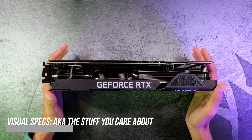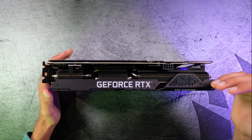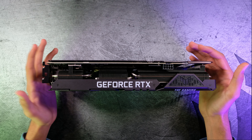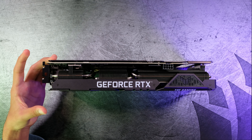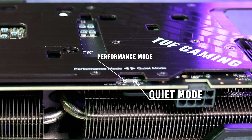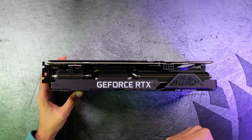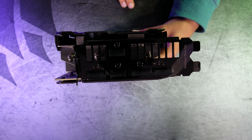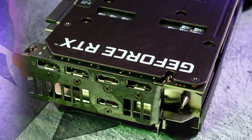Now let's move on to some of the practical specs. It has an 8-pin power connector. The website says it needs a 750W power supply, but I would recommend 650W because it's not that power hungry — you can even run a 3080 on 650W if you really want. This is a 2-slot card, but you want to make sure your case supports 3 or 4 slots for extra airflow and fitment. It has a dual BIOS with a performance mode and a quiet mode. I would always recommend performance mode since this GPU is already going to be quiet with 3 fans. For I/O, we have 2 HDMI ports and 3 DisplayPorts — pretty standard, but it'll fit most needs.